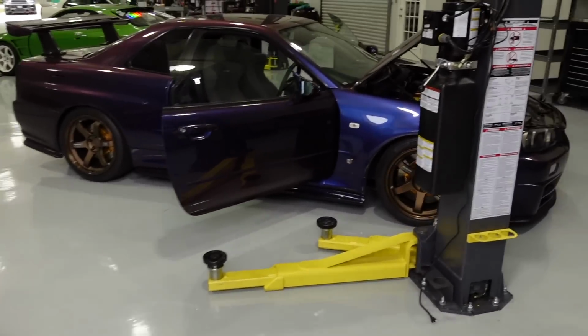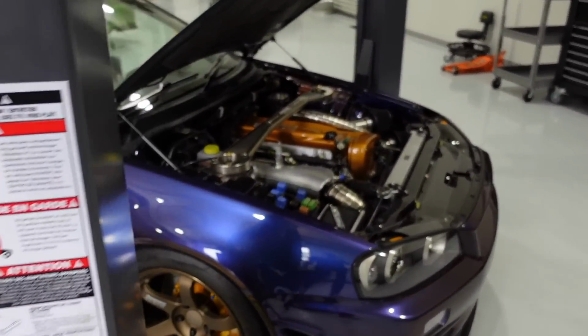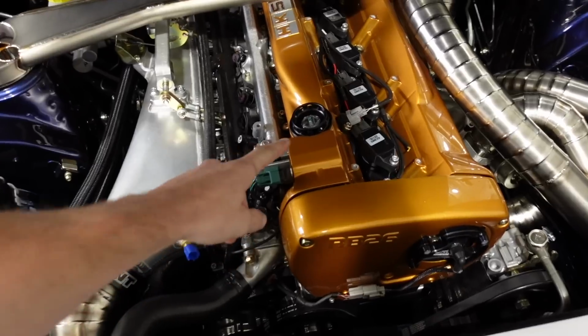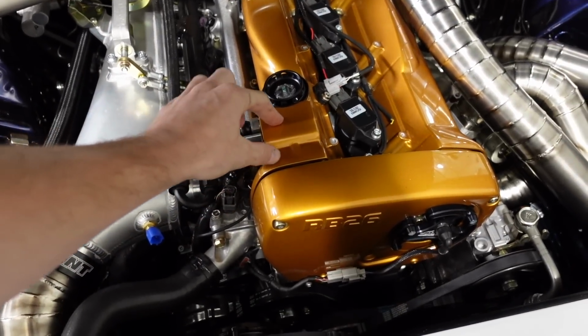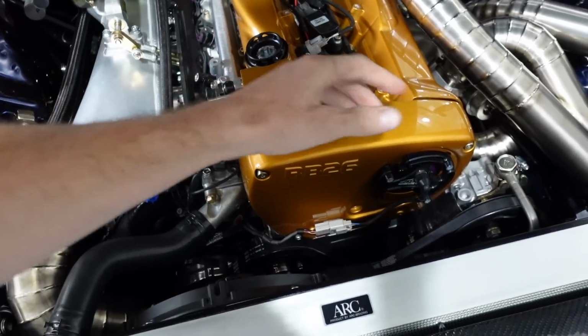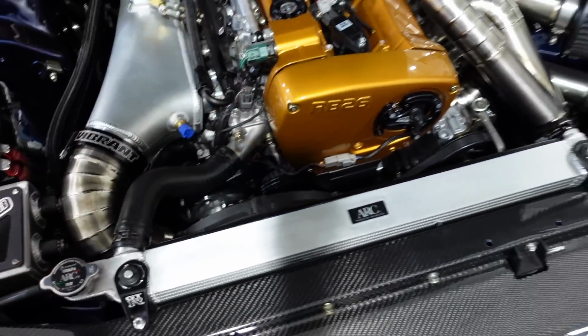I know a lot of you guys ask why I haven't been doing a lot with the R34. Kind of complicated, kind of simple. I've explained it in some videos before. Originally, when we got this car wired up, we were having some issues with the crank signal. So we did a little ghetto trick and ran the car entirely off the VCAM sensor. It has the same effect as a home signal, and we could pull RPM from it like you would from a CAS or a crank signal. But at high RPM, it started getting a lot of noise.